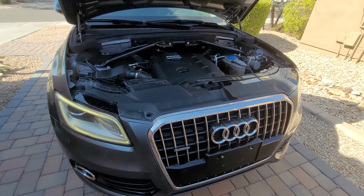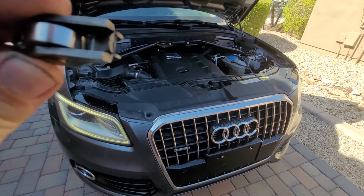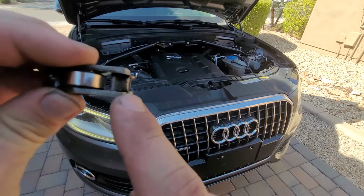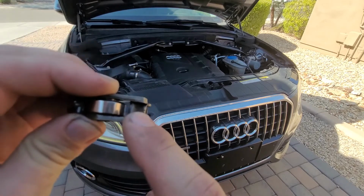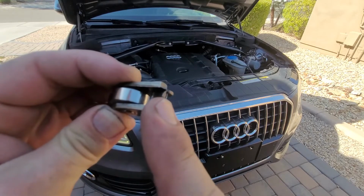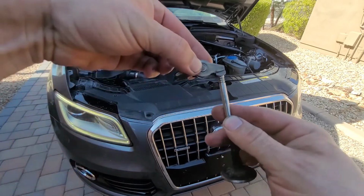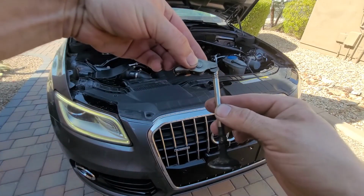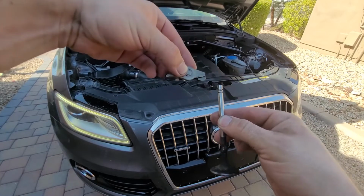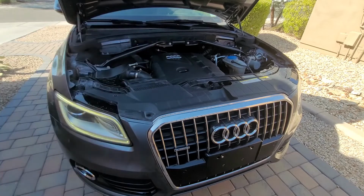For the first time ever, I had a rocker arm issue. I don't know if you're gonna be able to see it. There's a hairline crack right there. It's probably not going to focus on you. You can see it right here. Anyway, where this goes to push down the valve, when the piston hit it, it cracked the rocker arm. It's the first time I've ever come across that, so all intake rocker arms got replaced.